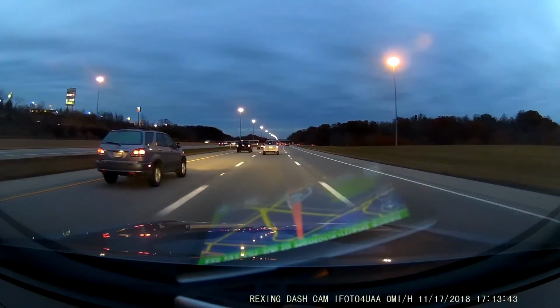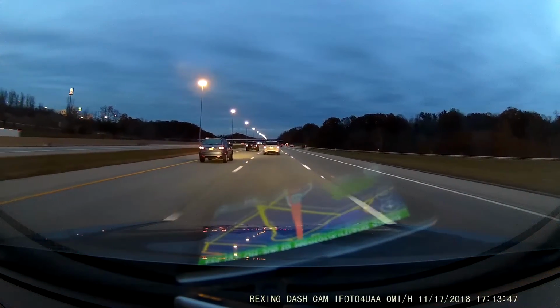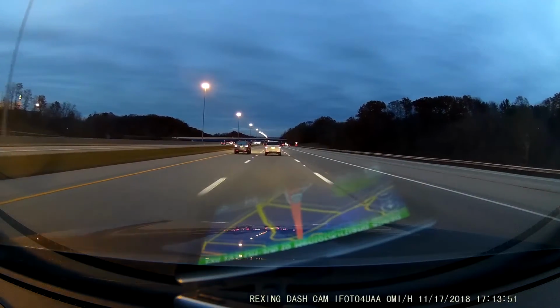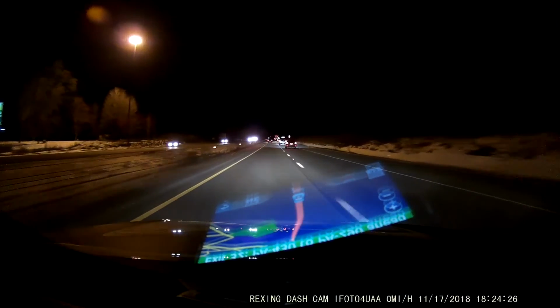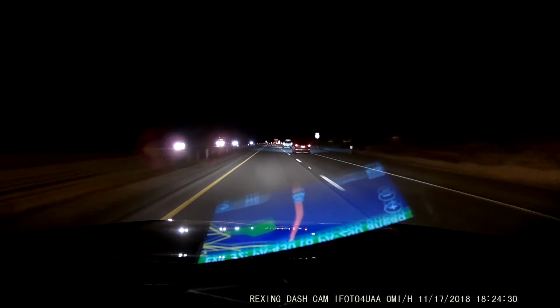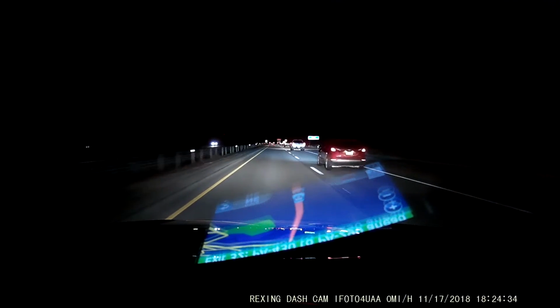And remember, if the display is not legal, you can turn that display off and the unit still records. So as long as your car is running, it's recording. When you shut off your car, it continues to record for 30 seconds, but you also have control over how long it's going to record when your vehicle's off. Plus, you can have like a scan unit where it takes a shot at intervals and you can scan a parking lot, for example, for security.